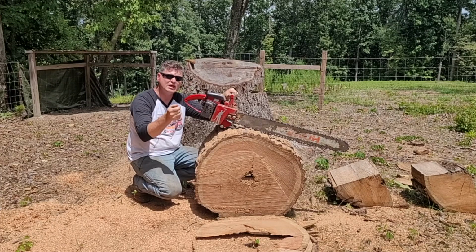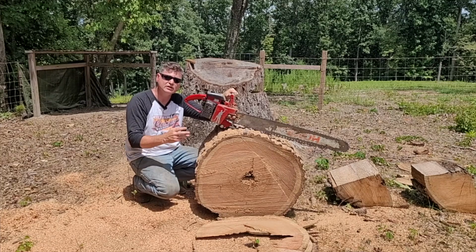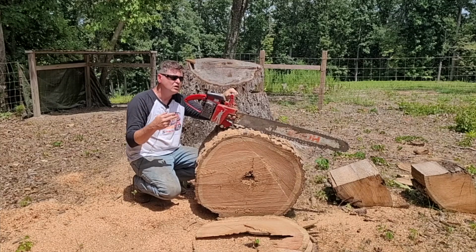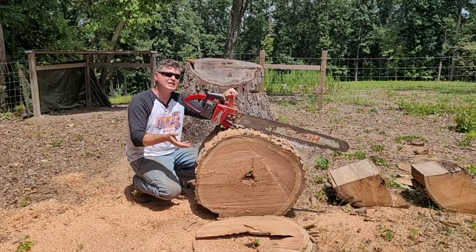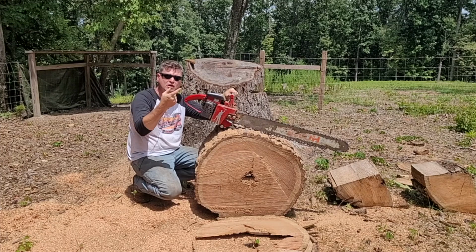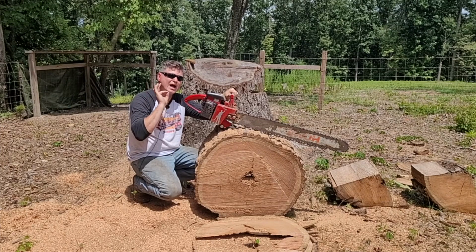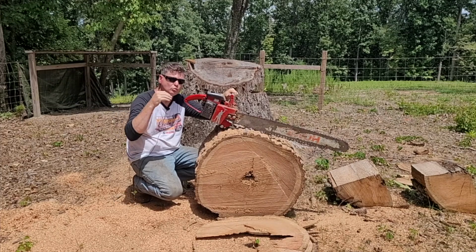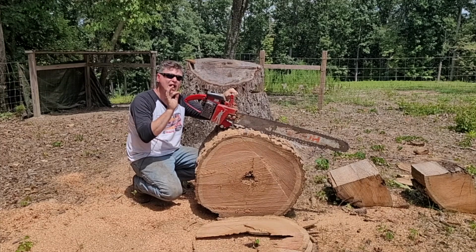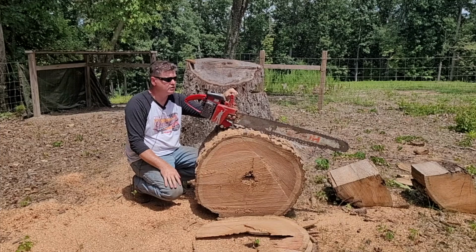But every time I do that, I'm taking too much away from my high side, because, guys, if you don't already know this, your low side does still provide fuel flow for the high side as well. So if I lean out the low side to get it to idle where I want it, then I take away from the high side, and that's when it starts to bog. You saw me giving it the trigger and it wanted to bog right off of idle. So I need to fix the idle adjustment screw and get it to where I can turn the idle up by moving the butterfly of the carburetor. That way I can keep the low side where it needs to be, richened, so the throttle doesn't bog. So that's what's going on, I think, anyways.